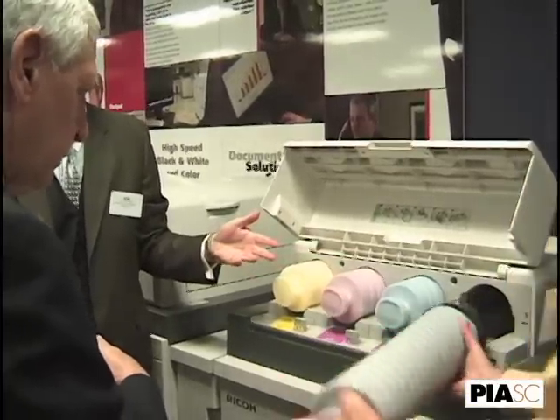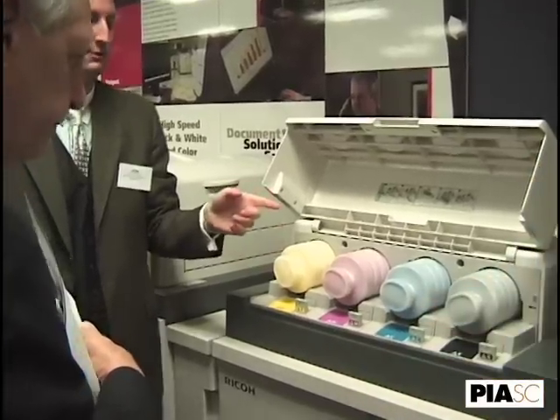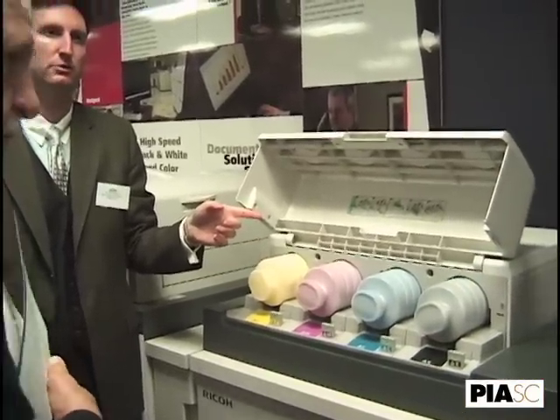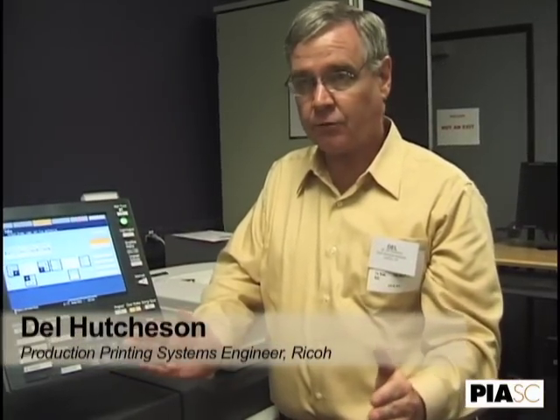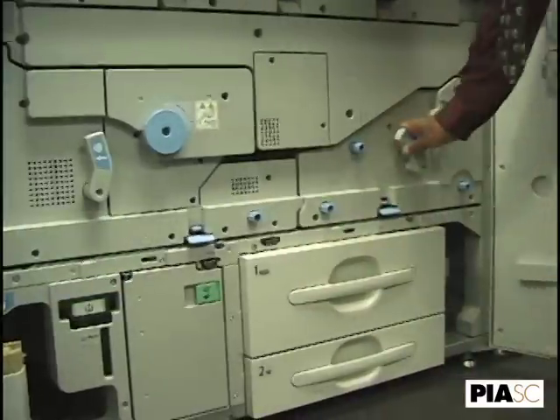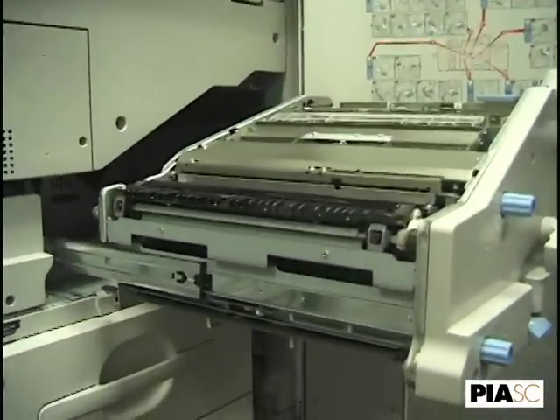We can't get them wrong in any sort of way. Very self-contained. I believe it's 72,000 prints — about that — at 5% density. What happens is the printer goes through and it has a sensor that will sense the side-to-side drift of the paper, and it will make an adjustment on the image from how it writes the image. When the paper goes through the duplex, again it drifts and it takes another snapshot and then locks the images to that. So it's constantly watching the paper. This is the registration assembly. Registration specification is 0.5mm front to back.